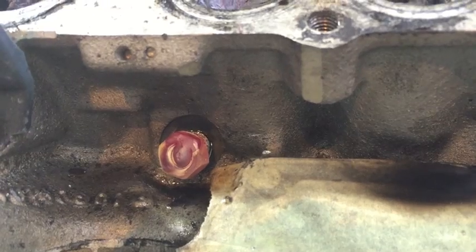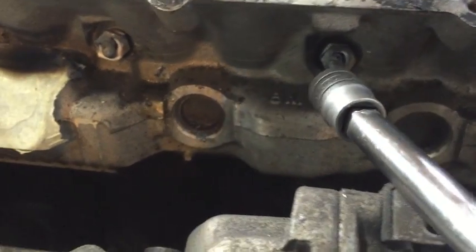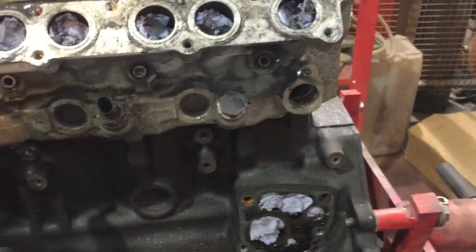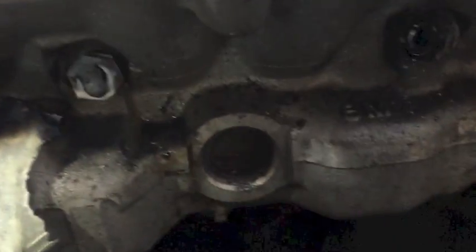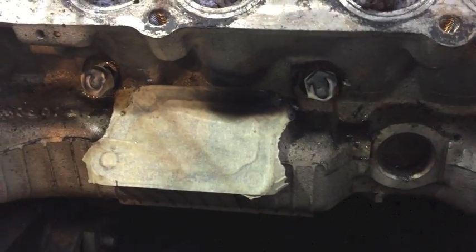And after we've just welded them on there, all we want to do is use that little bit of weld so we can grab hold of the nut and twist it out. Nut welded on, and we can just basically twist that round. Then, once that's twisted off, there we have it. So we rip that out, and now we've got a nice socket that we can drill. Just do that to the others, and Bob's your uncle.